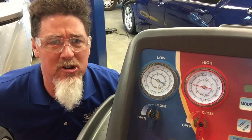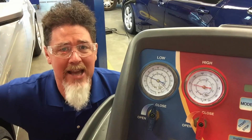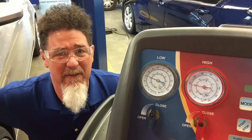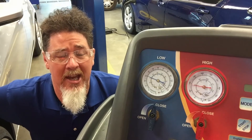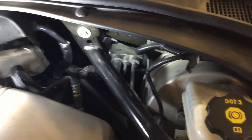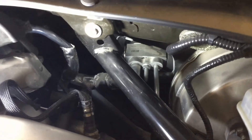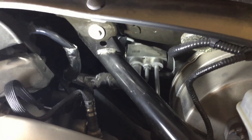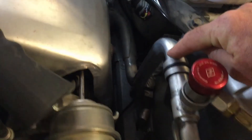What I wanted to see is what type of pressure differences we would see on this particular unit. Obviously it depends on where your service ports are. The high side service port on this vehicle is right in front of the internal heat exchanger but the suction line is after the heat exchanger. I'll show you a picture of the heat exchanger. You can see the TXV on the bulkhead and the power dome right at the end. The power dome is where you put your CLT when you want to do the TXV test. The liquid line is the small line and the suction line is the large line coming out of the TXV — they connect to each other through what we call an internal heat exchanger, essentially a tube within a tube.